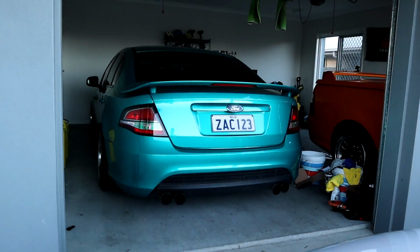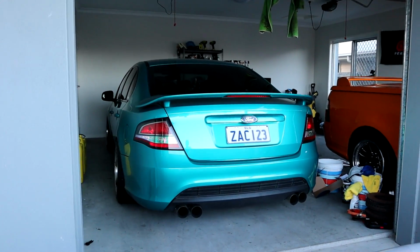If you guys remember, the new turbo has a, what would you call it? Wastegate pipe sort of thing. Yeah, it's got a wastegate welded onto the exhaust housing on the turbo. So what we're going to have to do is either leave it external or plumb it back into the standard dump. I do love the exhaust on the Falcon, and one of the things I would love about the external gate is that you guys will be able to hear it in person.